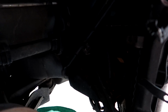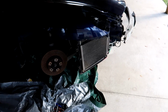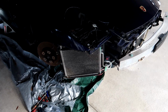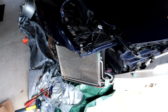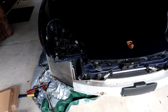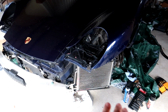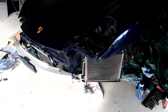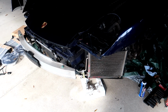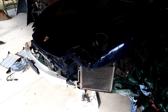While we're in there, we're going to do the radiator, the fans. How about the condensers? I know it's an added thing. These condensers probably function just fine, but we're going to get them done because that way this car will hopefully go for another 100,000 miles. We won't have to remove any of this front stuff again. Luckily, I've had a friend come over. He's already evacuated the AC system, so we're good to start disassembling all of this stuff.